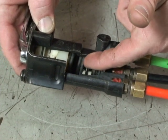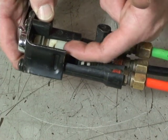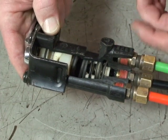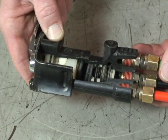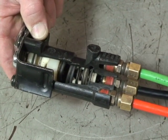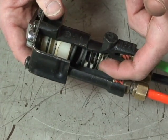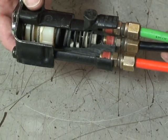As the driver pulls on this, air will then react against the relay valve, and as soon as the air equals the force being applied on the cam, it will go into a balanced state. So if the driver gives it equivalent to 10 psi pull on the spike, as soon as we get 10 psi in here, it goes into a balanced state of hold. If he pulls it more and wants 20 psi, as soon as we get 20, it goes into a state of balance and we have 20 delivered out to the system. When the driver releases the spike, the valve comes back to the exhaust position, and the relay valve opens up the exhaust and allows it to be exhausted through the bottom of the valve.